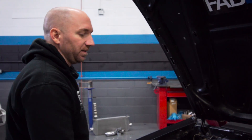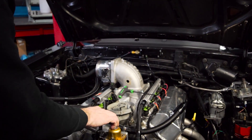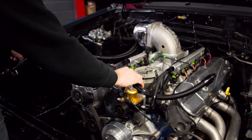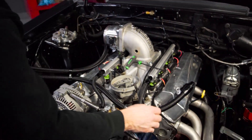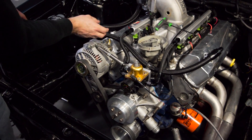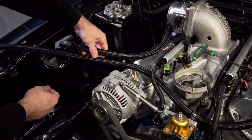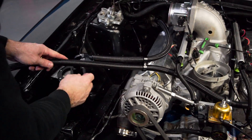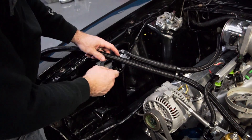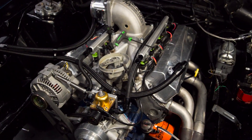I'm mocking up this second line — I've got it fastened to my valve cover over here. I've got it running underneath this fuel line and I've added a P-cushion clamp to this bracket so that I can help make sure that this hose isn't going to vibrate, isn't going to rub against something it's not supposed to — like this other fuel line here. I've got one of my line separators holding the two lines together; I'm going to add another one once this hose assembly is done. So I'm just going to mark where I want to make my cut, then pull this apart, make my cut, assemble my hose, put it back together and we're done.